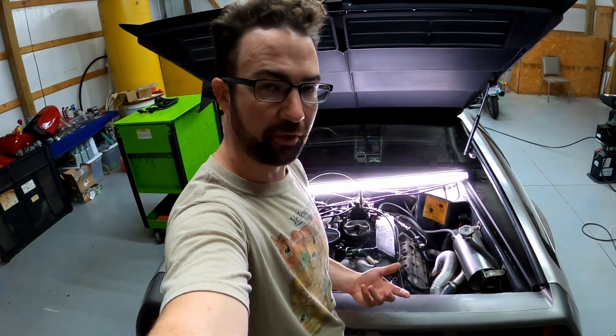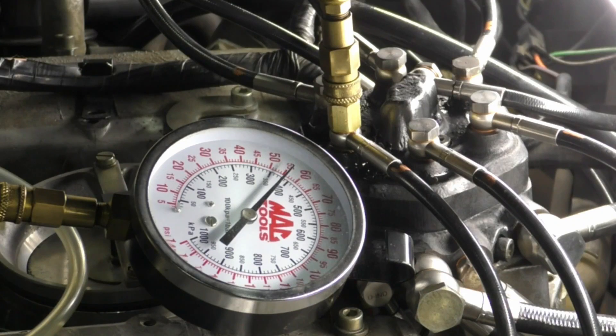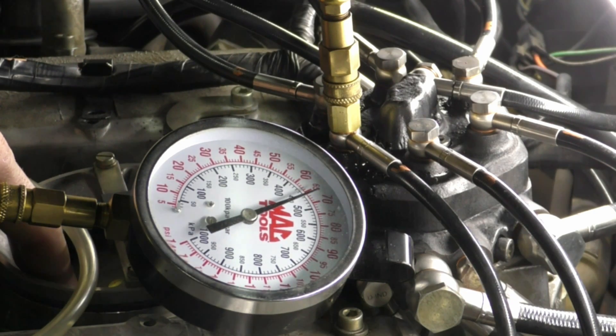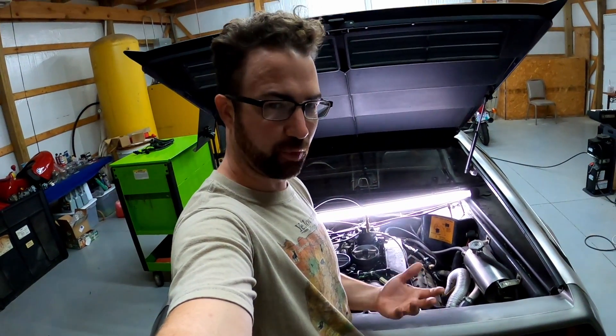Now that we've had a chance to do a compression test, we know that we've got good compression on all of our cylinders. I'm going to show you how to check the fuel pressure to each individual fuel injector. You can see here that what I've done is I've attached my fuel pressure gauge directly to the port that comes out of the fuel distributor, to the fuel line, and down to my cylinder one injector. So we're just going to verify that we are getting fuel pressure to that cylinder one injector. You can see that the needle goes up and the rest of the injectors are spraying, so we have plenty of pressure going to our fuel line, which means our fuel distributor is okay.